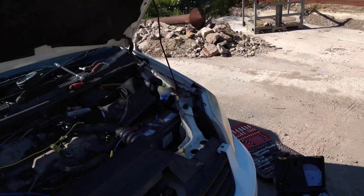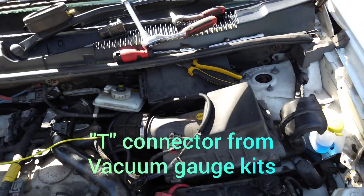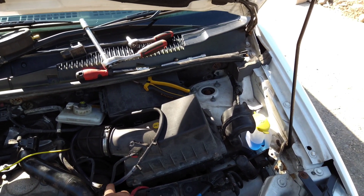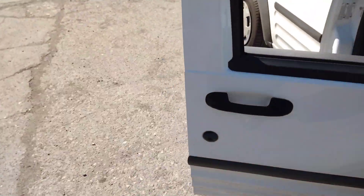What I've done is put some T-pieces into the DPF line. I had to put three of them in there before it would fill it up — two wasn't quite enough. I put three T-pieces in and it was happy, and it allowed me to do a regen.